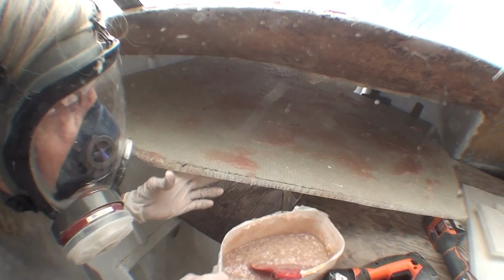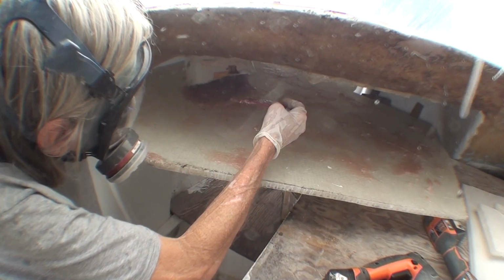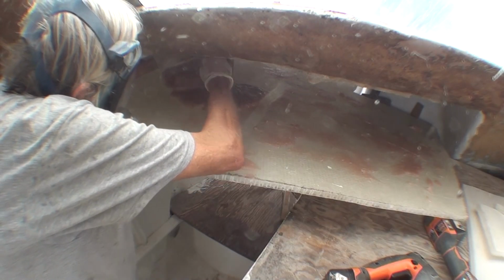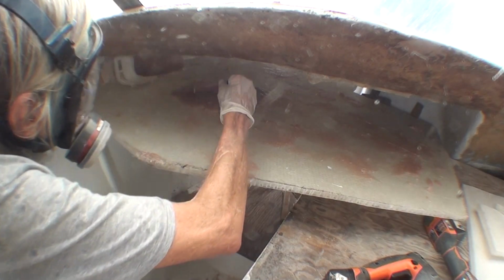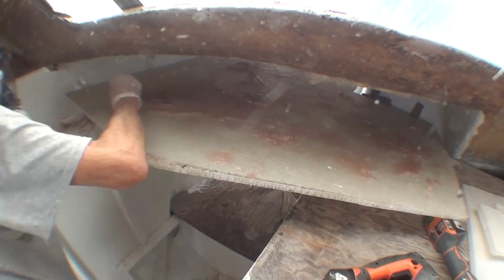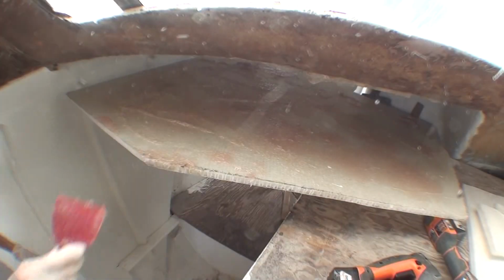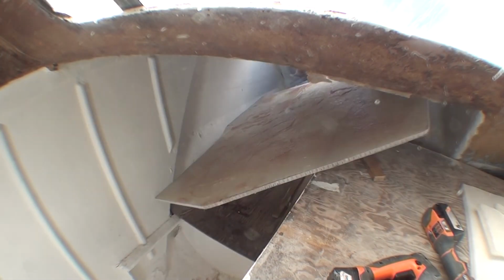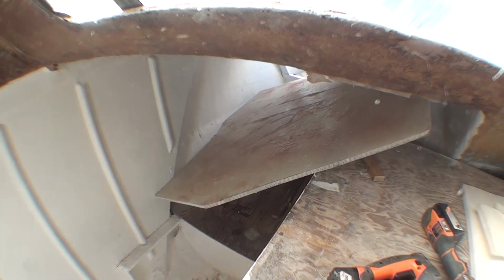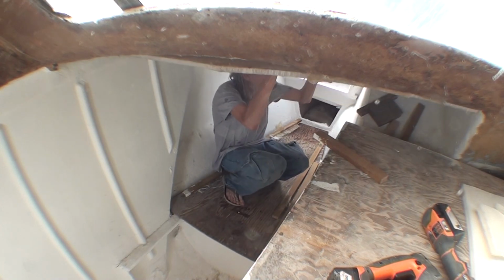So the time has come, and I've painted the ceiling with resin, and I've tried to spread some of the thickened resin on the ceiling, but it likes to drip off pretty badly. But fortunately, having the core underneath, it dripped onto the core. So I spread the thickened resin out some more on the core before sticking it to the ceiling.